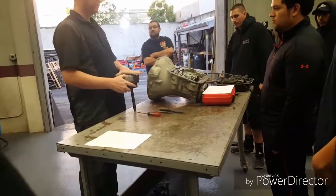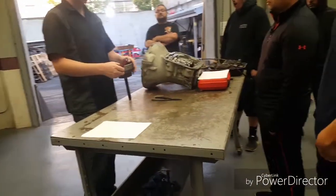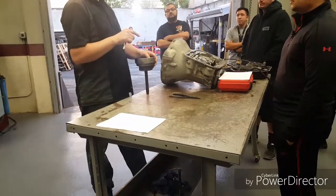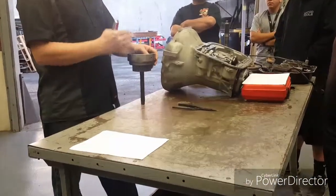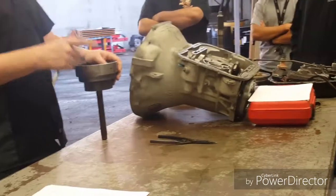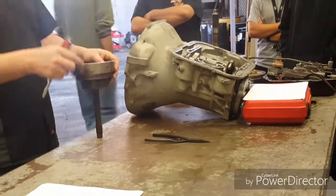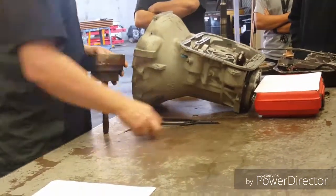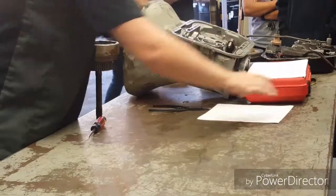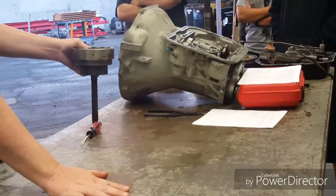Without anything flying out, what I would like you to do is, once you've got yours apart, look at some of the other benches. You get to see a much more dramatic change from bench to bench on the size of the clutch pack based on what transmission this thing went into. So just like before, have a clean spot on your transmission. It's more critical than anything else that you're not piling this up on dirty parts.